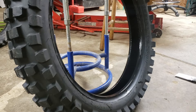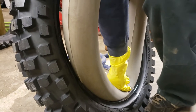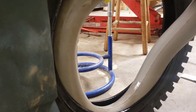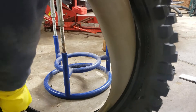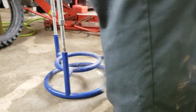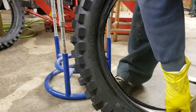Now the fun part kind of starts. You want to start by putting the moose in the tire. I know some guys will put a little bit of air in the tube and put it in the tire first, but that's never been my style — I seem to pinch tubes that way more easily. I leave them folded up and stick them in the back of the tire after I get one side on the rim. To each his own — different things work better for different people. The only real challenge with this was that the lube had made the moose slippery, the tire slippery, my hands slippery, so you just have to kind of wrestle with it.